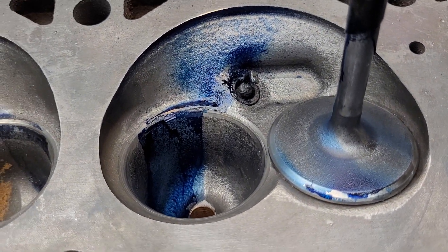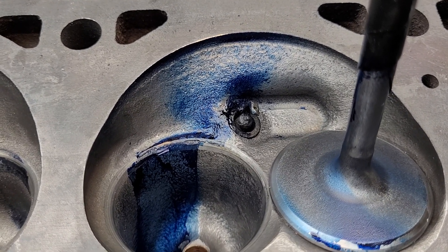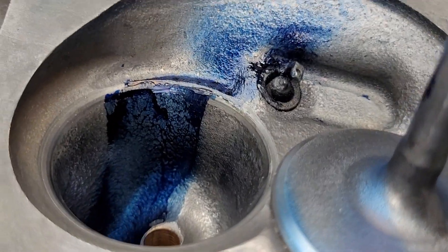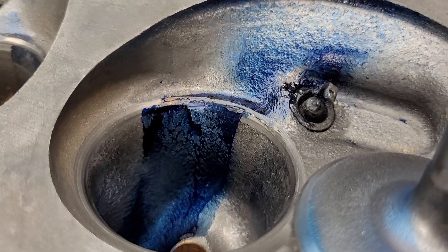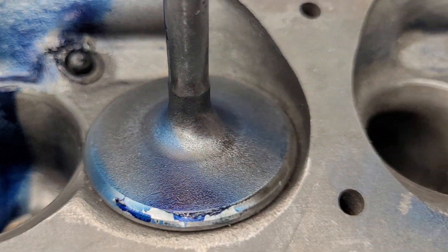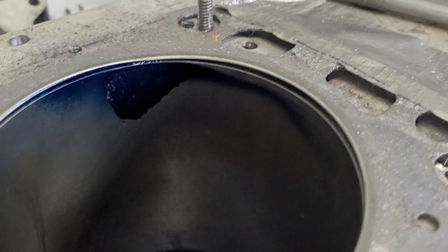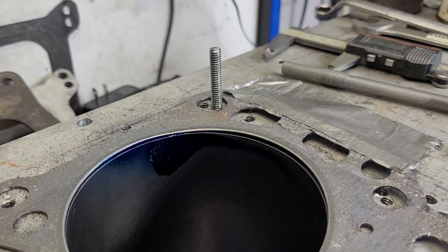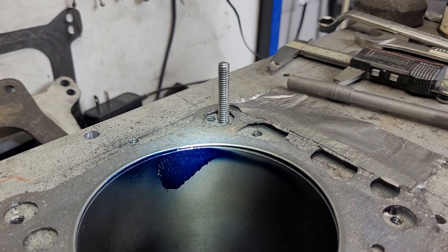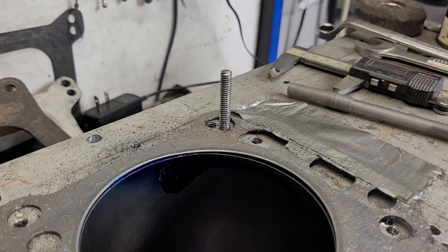The blue you're seeing was actually taken at 500 lift, 35 inches, which is 257.2 CFM. Our Dykem spray looks damn good on the valve - look at around that periphery of the valve, it looks really good. It really looks about the same as it does at 28, so I'm good with the fuel spray.